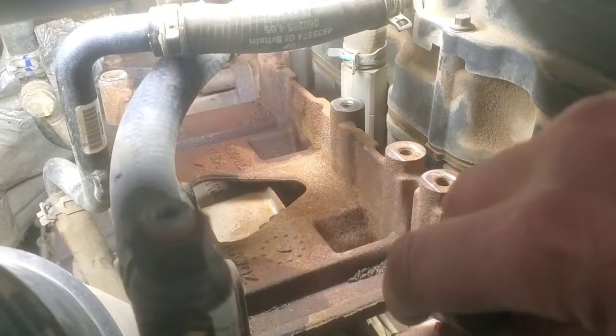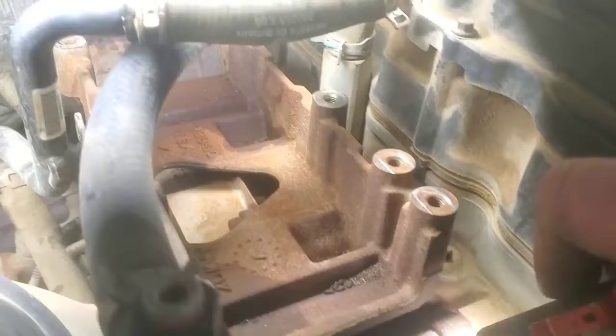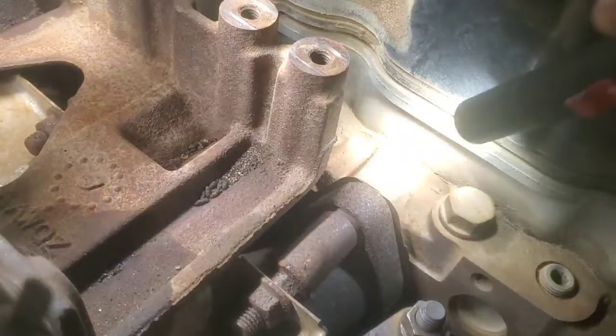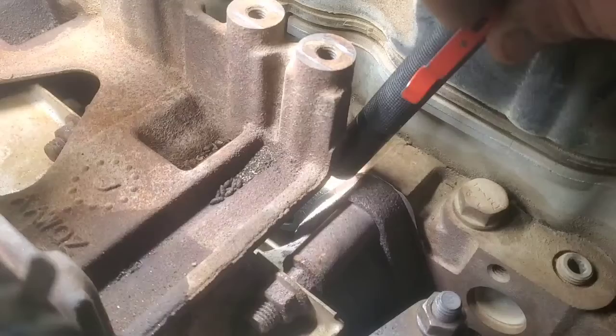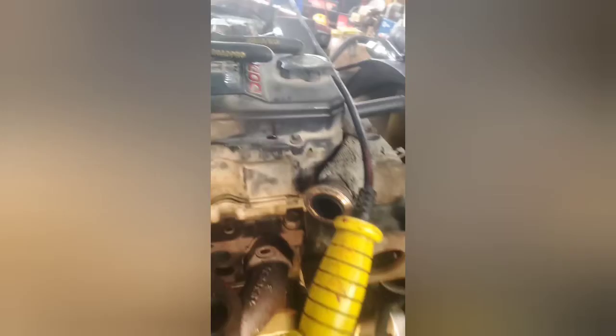This thing's actually a lot louder without that EGR cooler on there. Without it on there I can also get down in here and see - there's a big soot trail coming right off the middle of this exhaust manifold. I really wish these LEDs weren't so bright. Some days these vehicles will receive my blood, sweat, and tears - and I mean that literally. Bleeding all over the place before I realized it. All the joys.